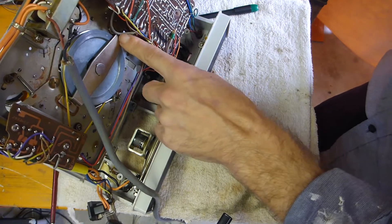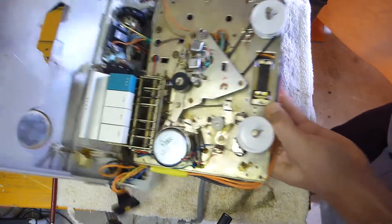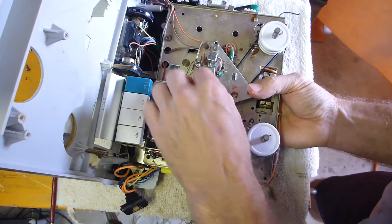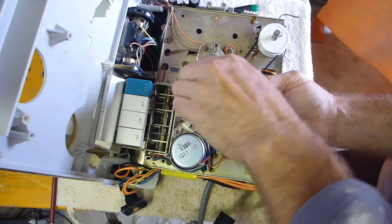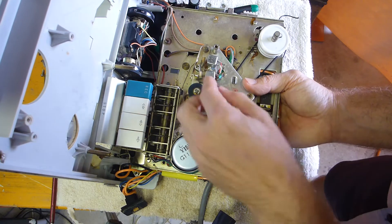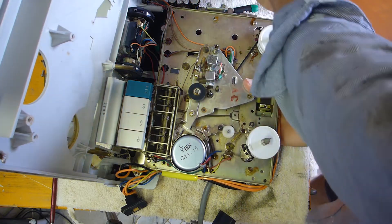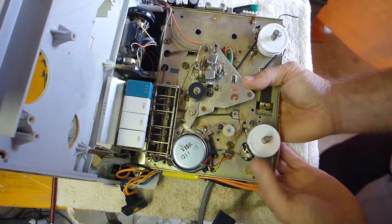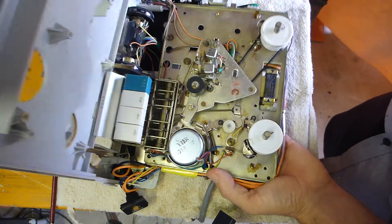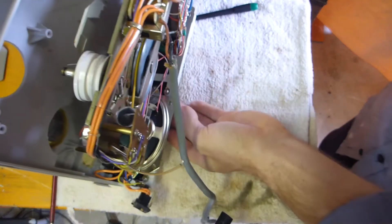These screws basically secure the flywheel, and I've also got to remove the main capstan drive. If you get your fingers underneath you can just unscrew the top of the pinch capstan — you can see it comes off, it's a little threaded unit. Don't lose that. Then you can see the capstan there, and it's now basically only held in by the screws at the back, which I'll now remove, so I'm going to turn this over.